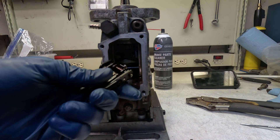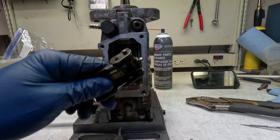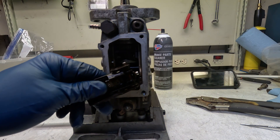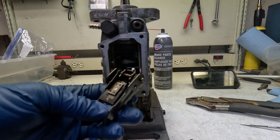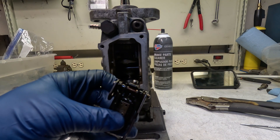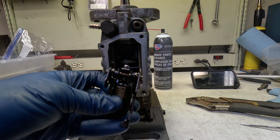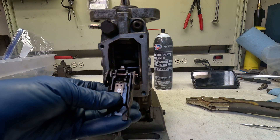Now we're going to put our fulcrum lever in, and if it seems like we've been doing things backwards, this is why. To make the big hammer full power MTDI you need to modify this to act like a direct injection pump. The stroke of these fulcrum levers on the TDIs versus the TDs is something I went into in greater detail in another video. For now I'm not confident in doing that modification because it involves lengthening this, and I'd rather make less power than worry about something welded rattling around in my injection pump. But if it turns out to be a pitiful amount of power, I want to see if I can take the fulcrum lever out from this step while it's still installed in the car to save time.